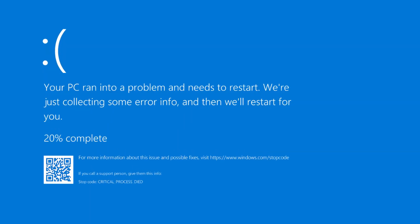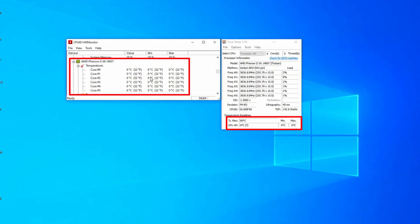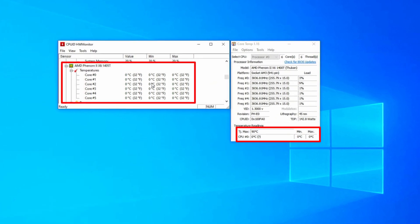Let's say you went through all of that and picked up a CPU and motherboard that could unlock — you're still not out of the woods. Just because a CPU will unlock those dormant cores doesn't mean it's going to be stable. Sometimes you have to apply more voltage to the CPU to get those dormant cores to unlock and be stable into Windows for daily use. What's more, if you had any intentions of overclocking this CPU, once you've unlocked cores, the temperature monitor inside the CPU die becomes disabled, making it impossible to monitor CPU temperatures inside Windows.